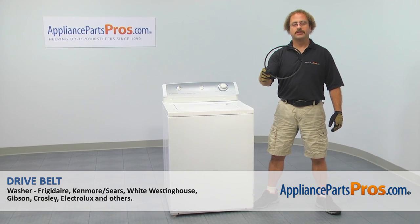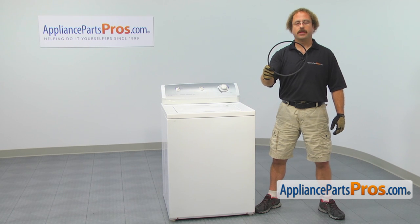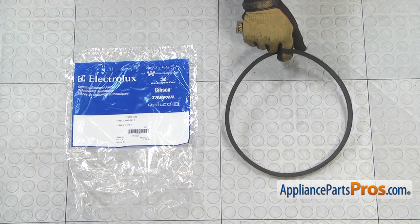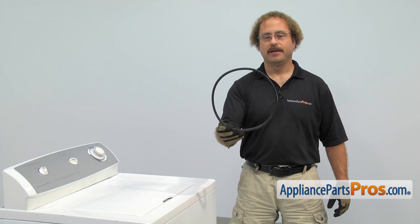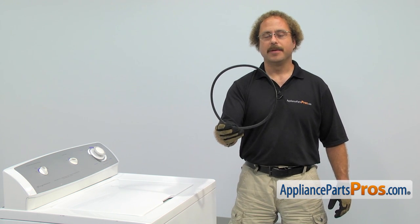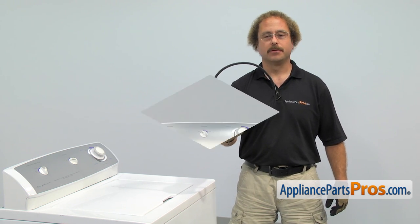In this video, we're going to show you how to change out the Frigidaire washer drive belt. It's going to be a very easy repair and it'll only take a few minutes. If you already have one of these, great. If not, you can click on the link below or get it at AppliancePartsPros.com. When you open up the package, you're going to get the new drive belt. The washer drive belt goes in between the motor and the transmission and it's what drives the transmission. The main reason to be changing it out is if it's worn or damaged and the transmission isn't being driven by the motor.